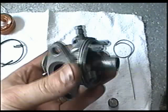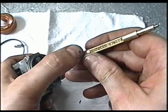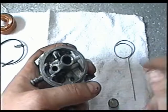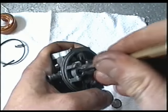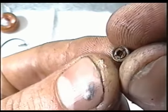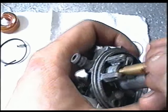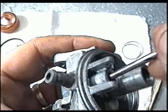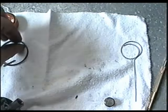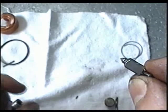If you don't have a problem with flooding, don't bother doing this. But if you do, you can use your Tecumseh tool or use a pick, wire, or paper clip to go in and retrieve the needle seat. If you get a new seat, make sure you put the side with the groove facing down — the smooth edge of the seat pointing up — and just reinsert it. If you don't have that tool, you can use a small drill bit to push the seat back in. Usually the needles are still good, but they'll come with the needle and the seat as a kit.